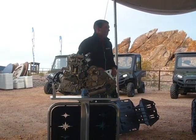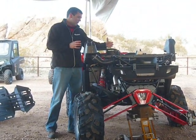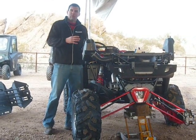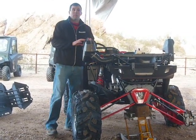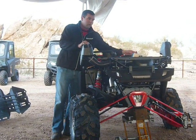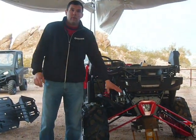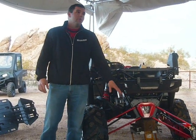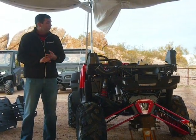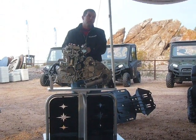That's a quick overview of the tuned intake — same thing goes for the exhaust. You may have noticed the engine is oriented differently than what we have in the 800 Razor model. The crankshaft is running from side to side of the vehicle — we call that east-west. One thing you get out of turning the engine in that direction is your exhaust comes out the front, and we did that on purpose. It's a tuned exhaust length — we didn't have to wrap around in the engine compartment, so it's a nice even flow right into the silencer. You may also notice it's stainless steel — for the consumer there are two reasons: corrosion resistance, and it's a much stronger material than using carbon. So it's a high-performance exhaust, high-performance intake, helping generate that high-performance, high-density power we're looking for in the side-by-side.